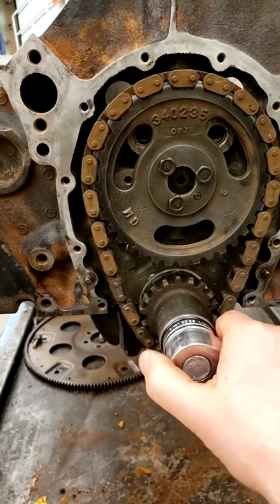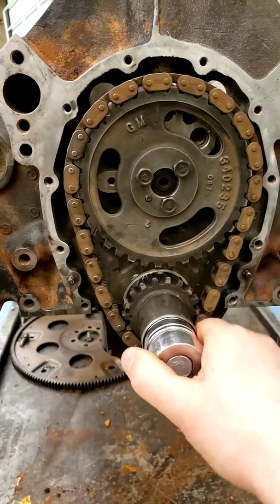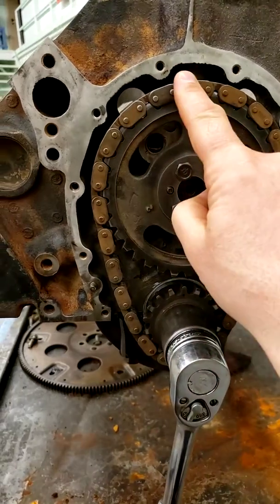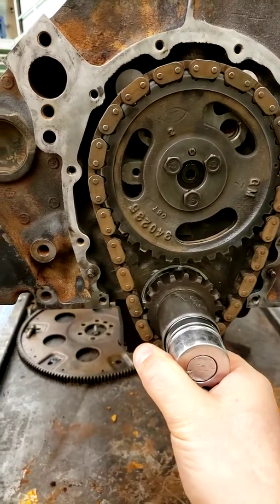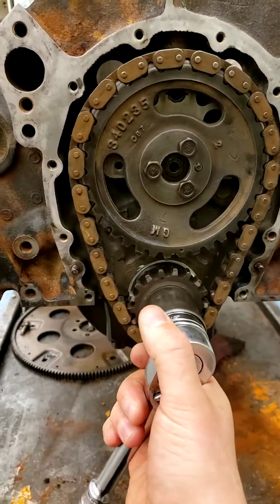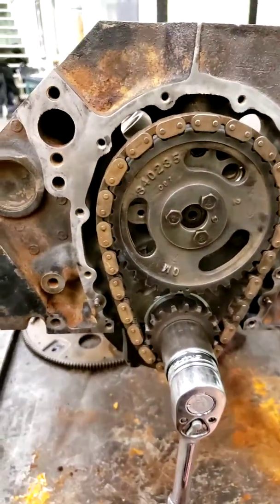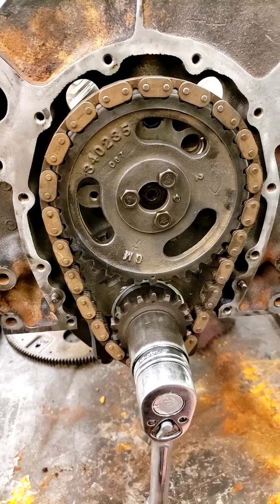So we go here, so we've got a half of a turn, right? We've done about a 1/4 turn on the cam gear, and we're coming up here, so that we've got 1 full turn of the crank gear, and so I'm looking at these dots. You can see that dot's there, and this dot's up here. So this is done 1/2 of a turn, this is done 1 turn. We go around again, so there's about another half turn on the crank gear and about a 1/4 turn on the cam, and now we finish the cycle. So we've done 2 full turns of the crank and 1 full turn of that cam. So that cam has opened the intake valve once and the crank has turned 2 full turns, allowing that piston to come up and down for the 4 full strokes.